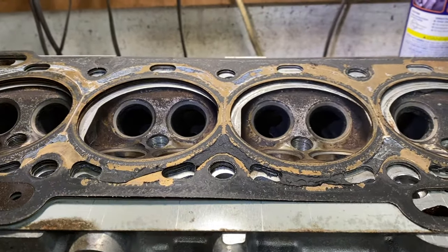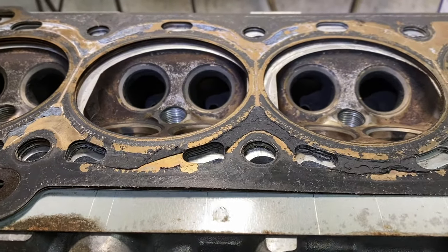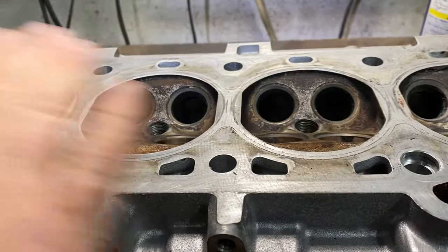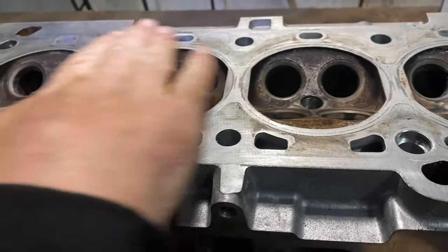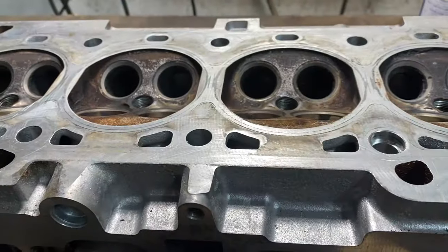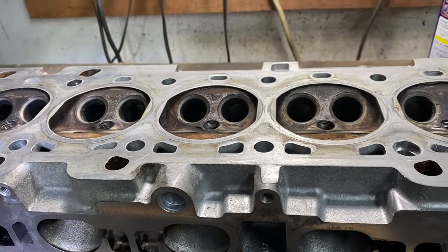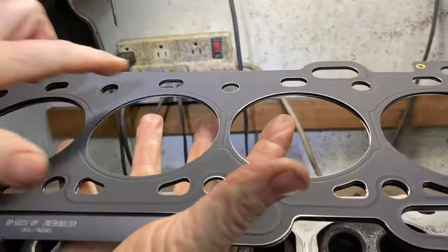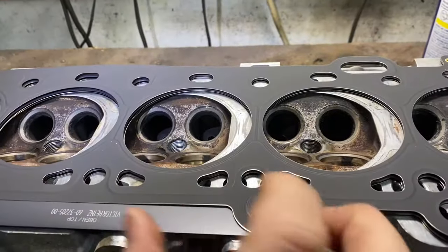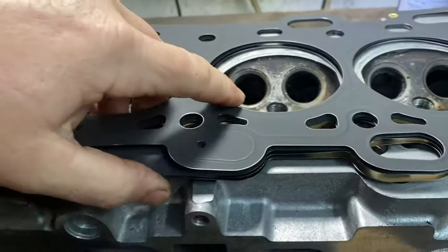If you don't believe me, look up your favorite head gasket sealer or block seal on the Better Business Bureau and you'll see all the complaints right there. When a head is warped, it has to be milled perfectly flat again so all the passages, combustion chambers, and everything else is perfectly flat — same with the block. Then you get a brand new head gasket that has raised sealing around the compression and cooling passages, and you put it on after both surfaces are perfectly flat. That is the proper head gasket fix.